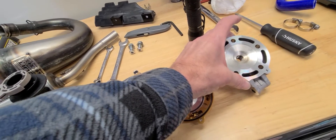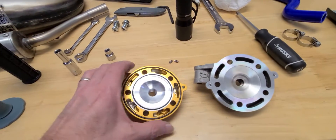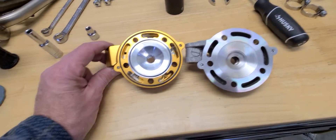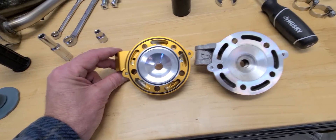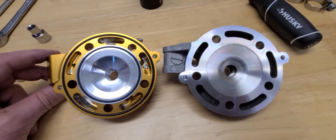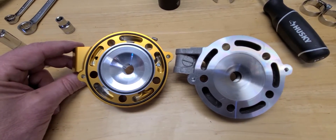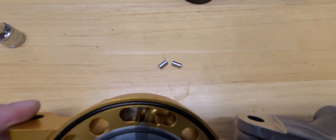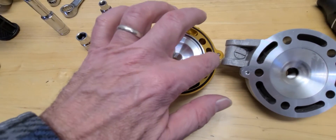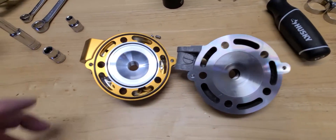To be replaced. Let me turn this so I can see it really good — I want a good comparison of these two. Because it's a bit of a risk, right? You order a part number, it should be identical. And it looks like it is. This is the Supercross insert that I've got in here. You can see the water jackets seem to line up. Everything seems to line up correctly. Now these little pins back here — those are the alignment pins, they came out of the stock cylinder head. They go in here and here. I'd say they're identical.